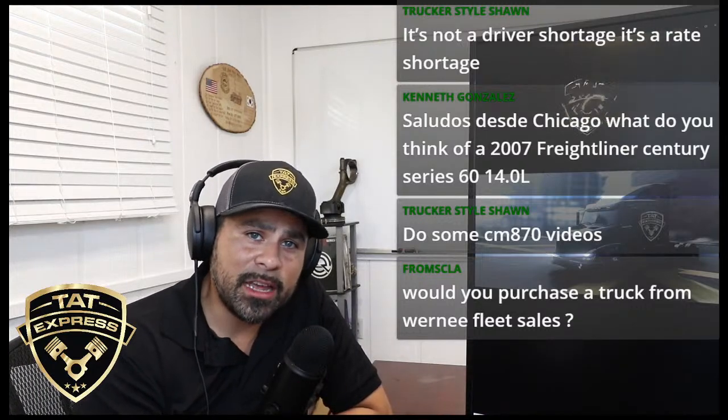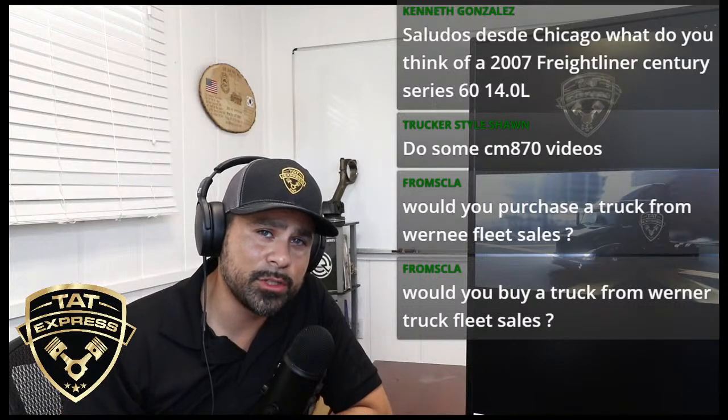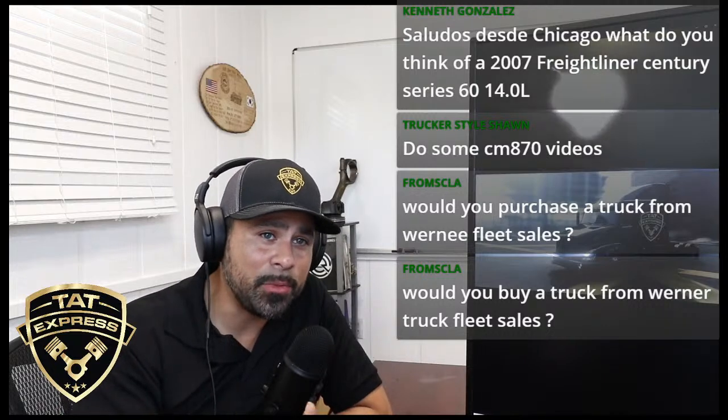Say, for example, you have high nitrate levels, too much nitrates. Higher nitrate levels will expose you to more corrosion. If your pH levels aren't right, your inhibitors might not be working as potently as they're supposed to. And if your freeze point is off, if you've got too much dilution going on, you can have a low freeze point or a high freeze point, and you can have your truck suffering some major damage.